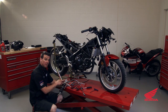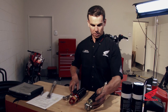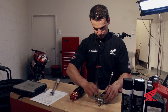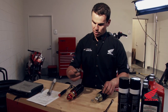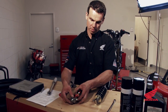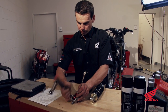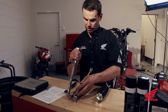There's your rear shock — we'll have to transfer the upper mount to our new shock. Now that we have our shock removed, we'll transfer the upper bracket to our new Elka rear shock. The bracket is reversible, but just make note that the nut is going to go to the right side when the Schrader valve is facing up. This bolt gets torqued at 55 foot-pounds.